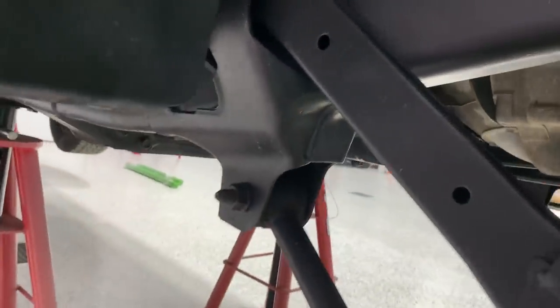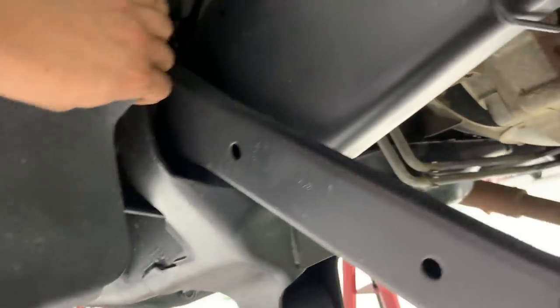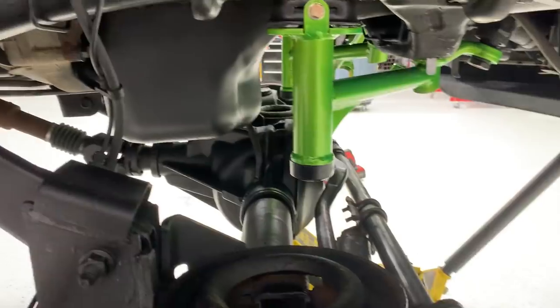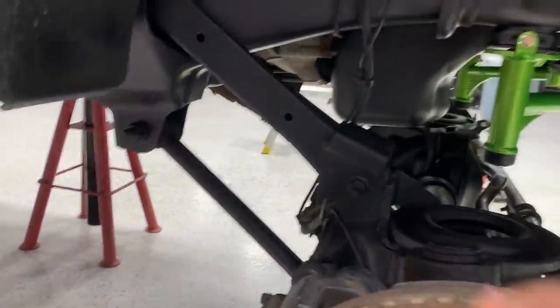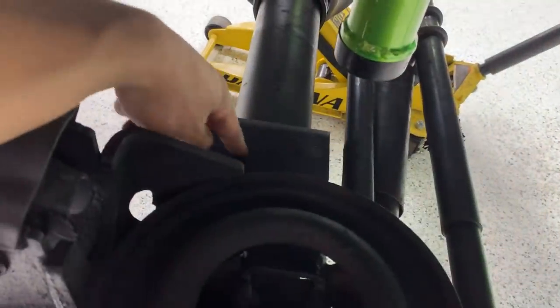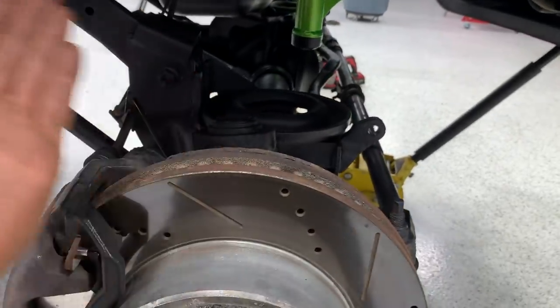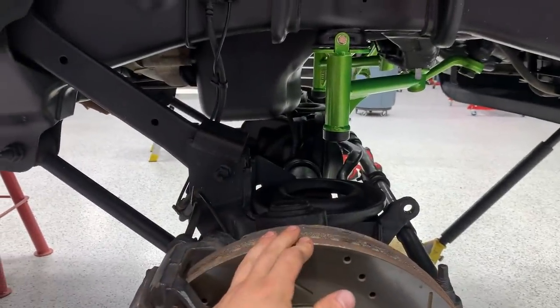The next step is attacking the four-link bars — the factory ones. I'm really dreading this. The instructions say this bolt up here doesn't come out — you've got to cut it — and it's definitely not going to be a fun time. As you can even tell now with the factory bars, see how far off this axle is? It should be hitting over where the actual pad is — that's how far back the axle is. That's why you get the new bars to push everything forward. With a six-inch lift, everything is just way off.